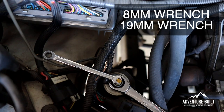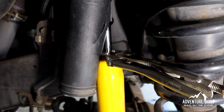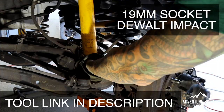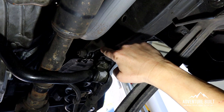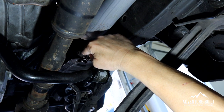8-mil wrench, 19-mil wrench. I got the top bolt of the shock off. Unfortunately, I had to destroy the shock — I had to cut away the top plastic protector part to expose the rod inside, and then grabbed it with a pair of vice grips. I really hope the entire day is not like the very first bolt. I'm going to remove the sway bar in two places, because the sway bar extension has to go in here anyway. I'm going to remove the main bolt here first, and this flexes.